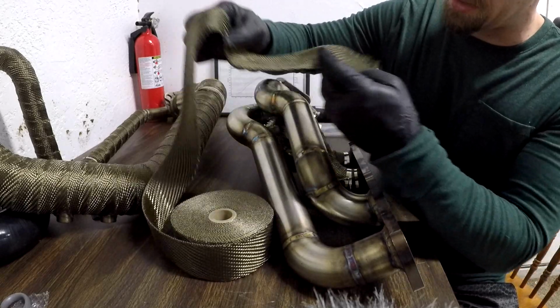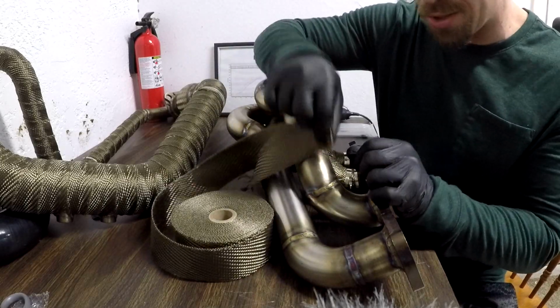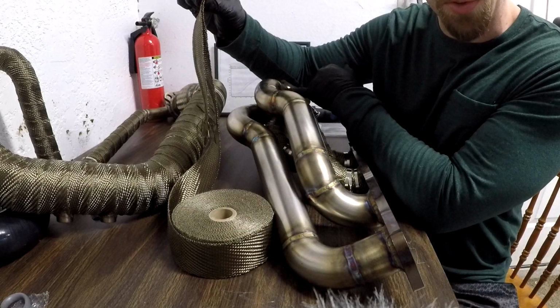And then take that portion out right there, and as you can see how long that is, that's how long it took to make just one actual rotation, instead of just measuring it. So I'm gonna take that and times that by 11, and then I'll cut that off, and it should be a good portion for this top runner.